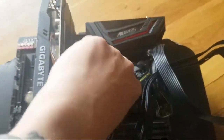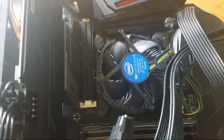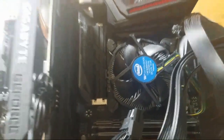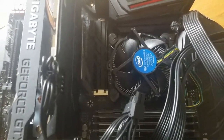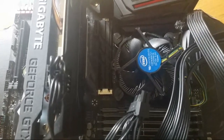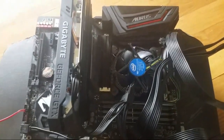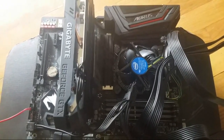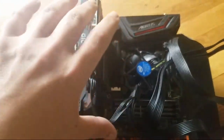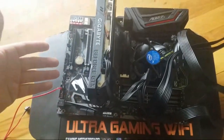So first thing you want to do, all right, this is your processor. I got a pretty solid processor. I think it cost me $99. You can get a $50 processor. You start getting into the i5s. They're real expensive. Now if you want a solid gaming computer, you can get an i5. Sometimes they're on sale for like $149, $199. That's really your 2 biggest investments, and motherboards you can get real cheap too.